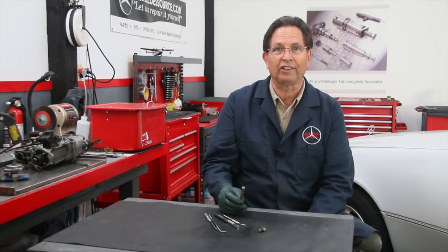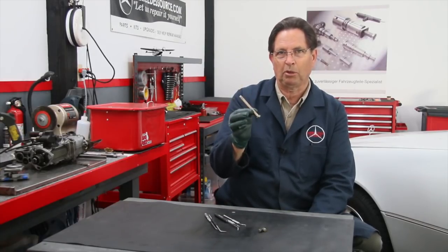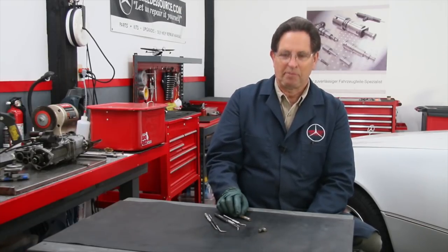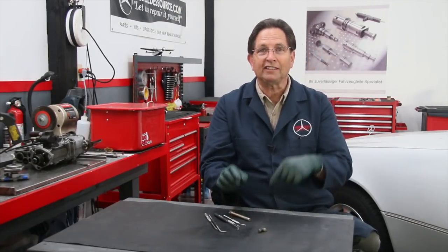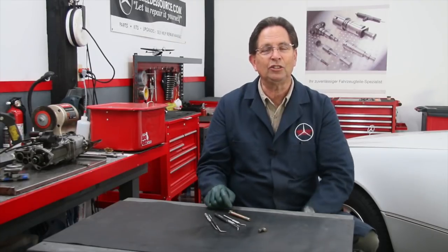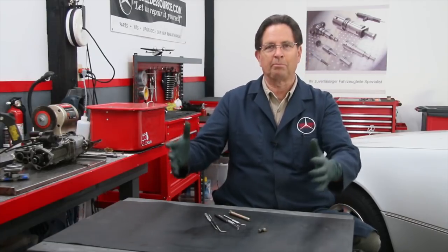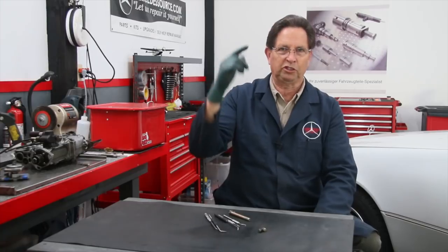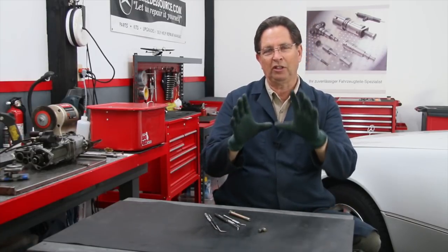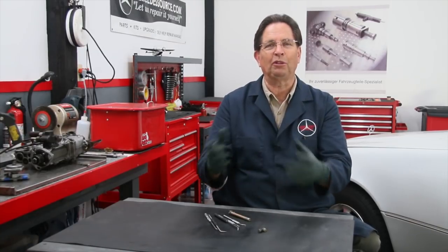Obviously, that had broken earlier, and the starter motor was only being held in with this one bolt, and it finally broke off, and it broke off cleanly. And guess what? Both of the ends of those bolts were down in the bell housing. Now, granted, if the engine and transmission were out, sitting on a bench, it'd be very easy. You could get a reverse drill or drill it and use an easy out. But down in that really tight confines, and I apologize, I wish I would have given him a camera.